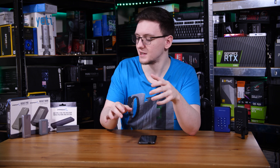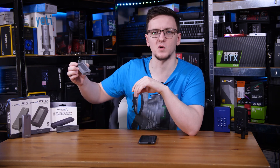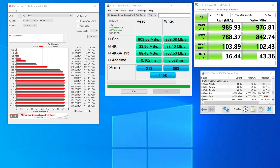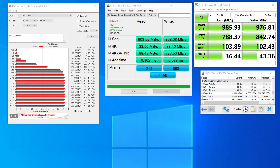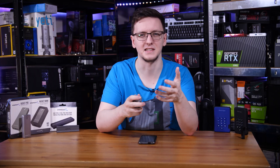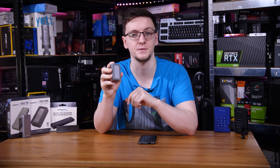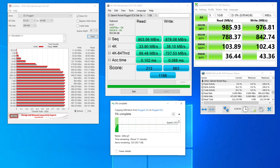Let's take a look at some performance numbers with these Sabrent drives specifically. Any of these drives are actually remarkably similar in terms of performance, so let's look at the rugged one since this is probably the one I would buy personally. Thanks to their USB Type-C and USB 3.2 Gen 2 — so 10 gigabit per second ports — this will write at one gigabyte per second and read at one gigabyte per second as well. This is incredibly fast as you can see from CrystalDiskMark and even the ATTO numbers, which read more like 930 in reads and 960 or so in writes. Copying a large set of files — about 98 gigabytes — to the drive, you can see that it writes at just shy of 500 megabytes per second, which is fantastic. And if you want to duplicate those files on the drive, stressing reads and writes simultaneously, that was still running at around 300 megabytes per second, which is faster than most internal SATA SSDs I've tested.